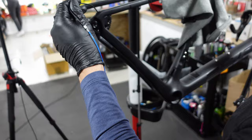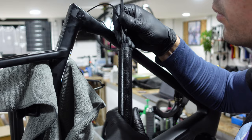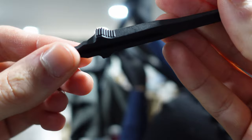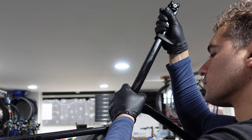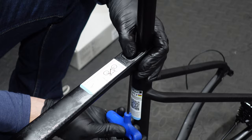Next we tackle the front derailleur cable — thankfully a shorter and much easier run from the seat tube down to the front derailleur. After routing the cables, it's time to connect both cables to the battery, requiring a specific tool provided with the Di2 groupset. When the cables connect to the battery, it's a very definite and satisfying click — hard to miss. However, it's not a true bike build without hiccups: we initially forgot the seat post cover, so we had to backtrack — remove the seat post, disconnect cables, fit the cover, redo the connections, and install the seat post again. The mounting bolt likes to push itself upwards as it tightens, but the seat post clamped pretty well.